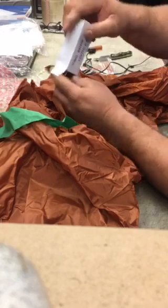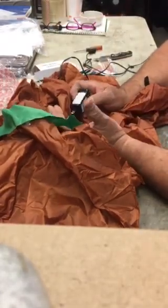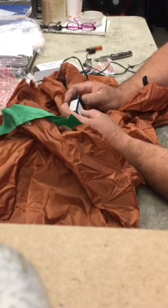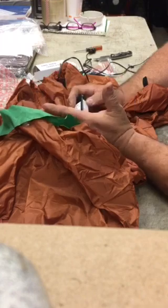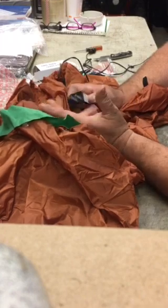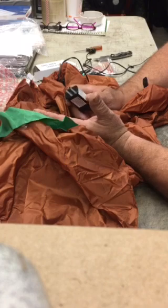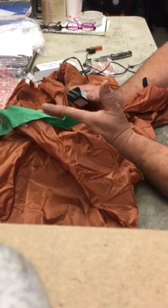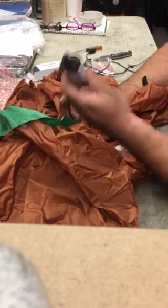We can try and test it out. Just remember that the LEDs — you can add an extra LED. The LED doesn't draw much, so you can add an extra one if you want to brighten it up. If you cut the LEDs and splice them, say you don't want to do all the button thing, you can splice it to the original LEDs because the LEDs don't really go bad — they last so long. Just make sure you have the polarity right on 12 volt DC when you make your splice.